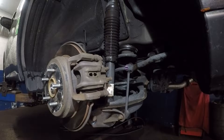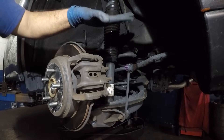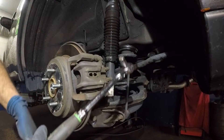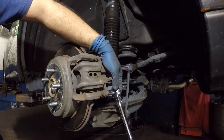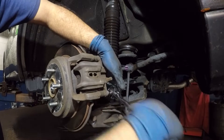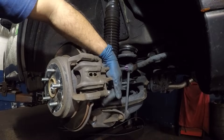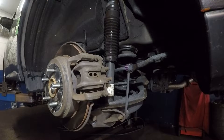To start off, you're gonna need a number 12 socket and a ratchet or a wrench. You're gonna remove the bottom bolt right there, right back of that caliper, and simply get that bolt out. Put it somewhere safe — do not lose it.